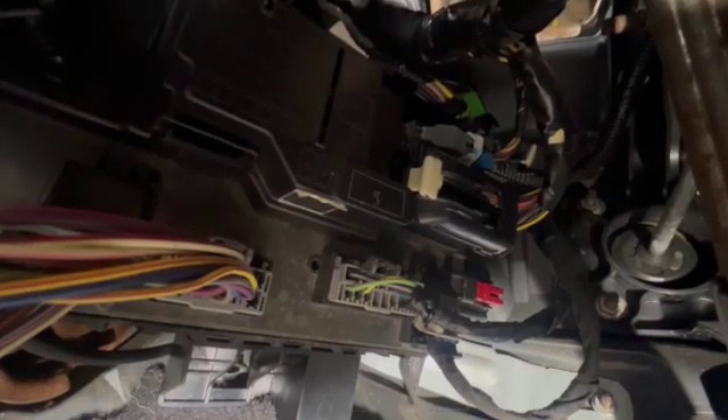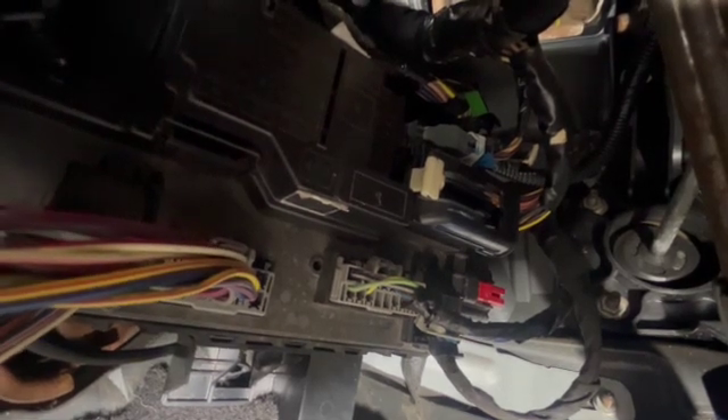This is where the little red lock connector goes. This is also the connector where I had to use the heater hose pliers to grab those tabs. One of the things I had to decide was: would it be easier to connect the connectors to the BCM and then slide the whole thing into the frame, or slide the unit in first and then put the connectors in? I went for option A — connecting first. I got all the wires in; there are seven total including the one in the back. Each connector only fits in one slot, which is the beauty of it. I have not slid the entire unit back onto the frame yet.